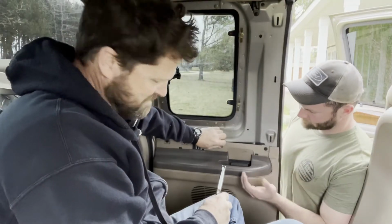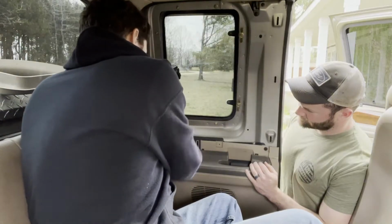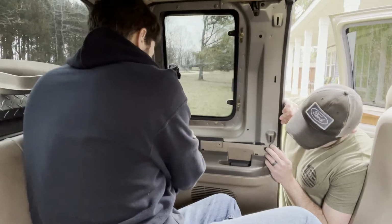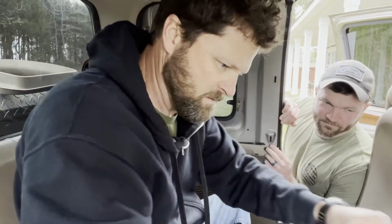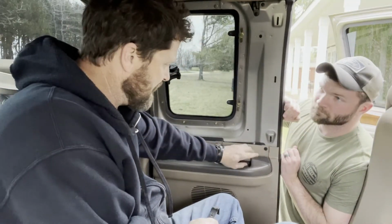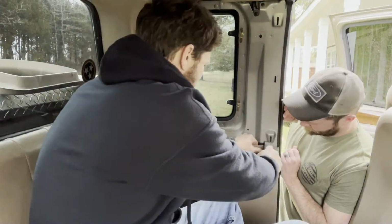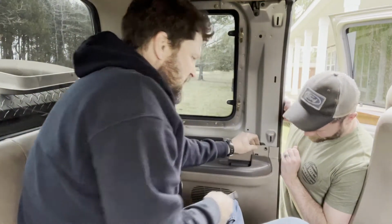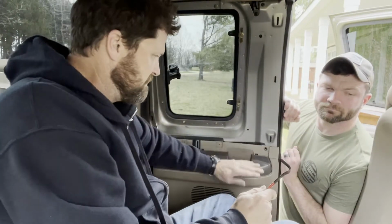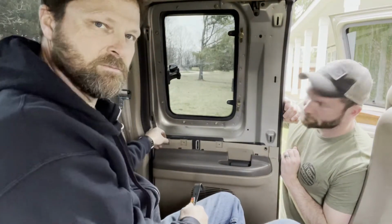Get them out of there. They'll come out. We got a little pry bar. These are little, I guess, plugs on the end. I pushed on the center part and the little center part fell in the door. So they're real fragile. I usually keep some extra little Christmas tree plugs for that, so we'll throw some in there. That one right there just came right out.